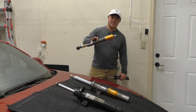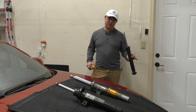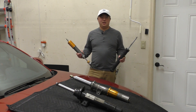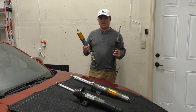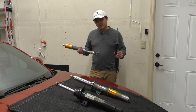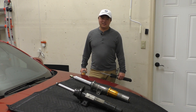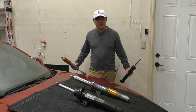So there you have it. The front struts are not interchangeable between F8X and F2X, F3X cars. The rear dampers — sure, you could do it, there are a couple of caveats, but if you know your way around these cars it's not particularly difficult. There's just really not a great reason to do so, since the F2X, F3X format is actually a little more advantageous. Beyond that, it's a decent amount of work to figure out whether an F8X damper would even be ideal on your 2, 3, or 4 series. Hope you found this interesting — thanks for watching.